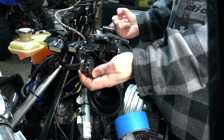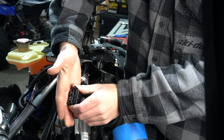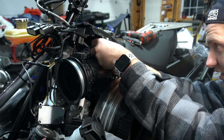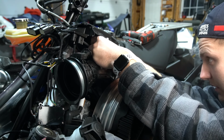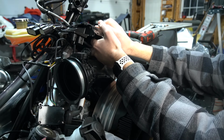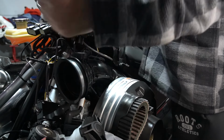When the switch is in the machine, facing in the correct direction, goes like this. They are to the inside. They're closest to the handlebar. So it's gonna sit like that up in. Okay, honestly, this is easier than the Gen 4. There's actually more room up under. So we're just gonna line up the metal contacts. Hold the button from the top. So now we're gonna have to plug in the two hand guards.